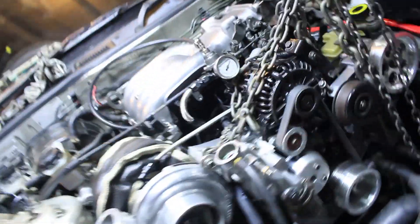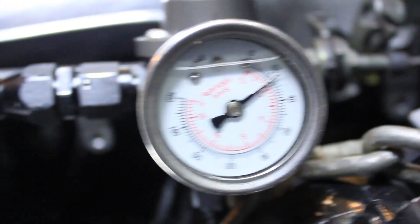The battery is actually a little bit flat at the moment so it might not prime - but there you go, you can hear it in the back there. That's fantastic! Let's see if we have fuel pressure. Yeah, look at that - only 20 PSI, but we can adjust that with the fuel pressure regulator.